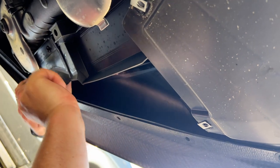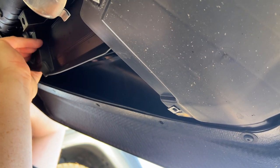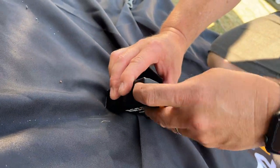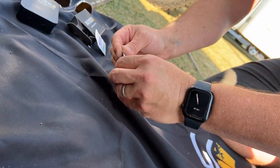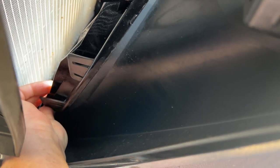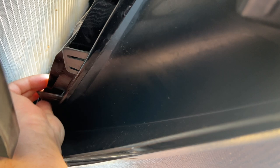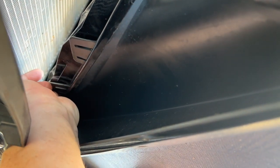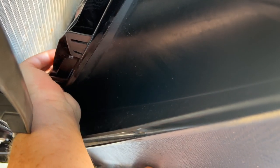He's up underneath there — you can see we are only on race ramps right now, so we don't have the vehicle up in the air. There's not anything seriously involved with this. As long as you have a set of ramps, you can do this. Inside the hardware pack is a couple of alcohol cleaning prep pads. These are specifically for cleaning off the areas where we install the lower brackets. There's an identification sticker on the lower outside corner of the inlets — just a paper sticker from the sub-vendor factory that makes this part for GM. To get our bracket to stick down, we remove that sticker, pick it off by hand, then use the alcohol cleaning pad to prep the surface for the adhesive.